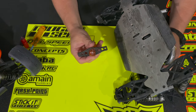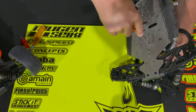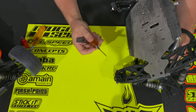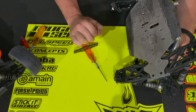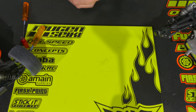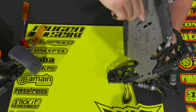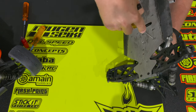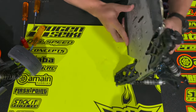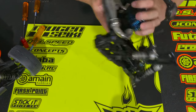I have this carbon tool to make it more of a T-handle, and I like to really crank these screws down. That was maybe a little too tight — as you can see I broke the tip off. I'll grab another wrench and finish these three screws. Same thing, going in a cross pattern. Now that I have all those cranked down, I'll check the mesh one more time — feels really, really good. I'll check by spinning the car — everything's really free.